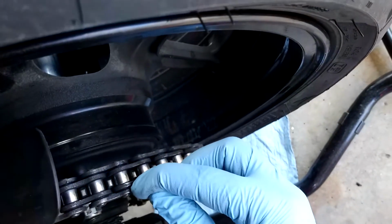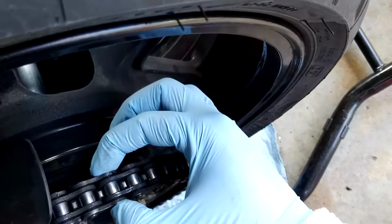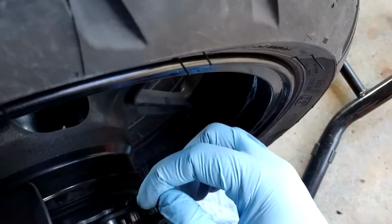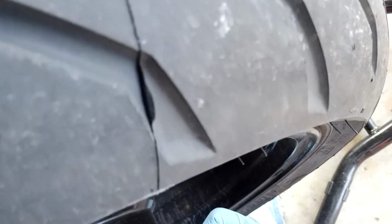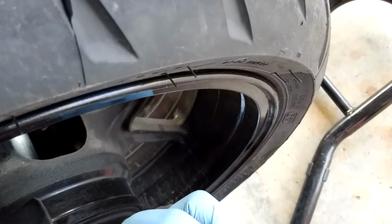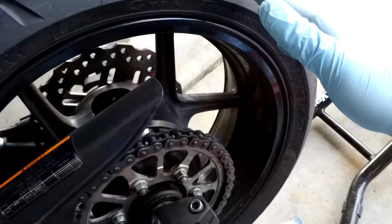These are the seals. Those are the X-rings that basically sandwich in between the plates on the outside of the chain and the inside of the chain to keep this nice and tight, but it also helps seal the grease that is inside of this roller to let your chain roll smoothly, because not only does it move around, but these rollers roll individually. So you roll your chain fast first, see if there's any binding or wiggling. It's shaking because I'm rolling it very violently, but then you roll it slow, see each plate, see if there's any locking up.